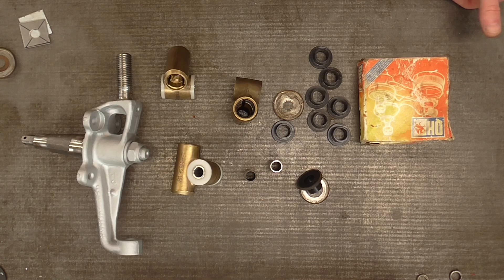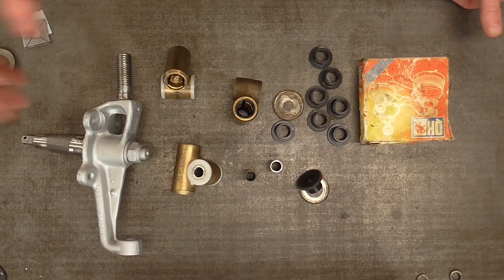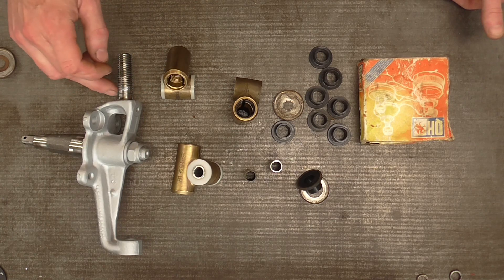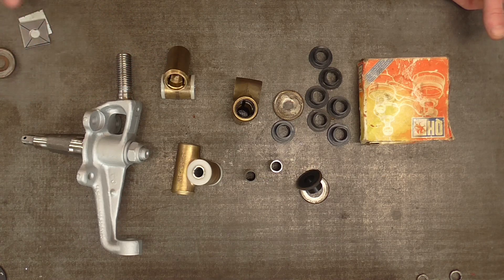These have a bit of a bad reputation, mostly due to poor maintenance. It's better to use oil. Triumph — and indeed Lotus, because these uprights are from my 1981 Lotus Esprit, which from 1980 to 1985 used this front suspension setup borrowed from the Elite and Eclat — always said oil is the most reliable way of keeping these lubricated and preventing corrosion of the top section, which can cause cracking and seizure pressure that will snap the bottom off.